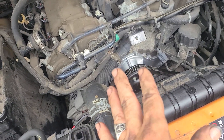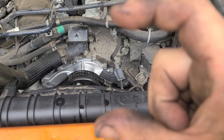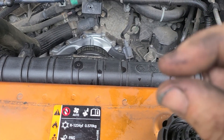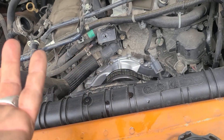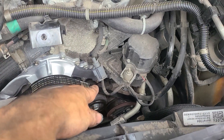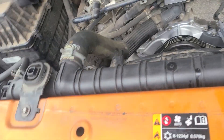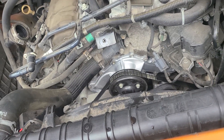There are about 14 10mm fasteners holding the water pump in place. They are different lengths — I think only two different lengths: some about an inch and a half to two inches long, and some about one inch long. The longer ones each have a rubber grommet centering thing that GM likes to use — you can transfer those over or not, up to you. Once you get all 14 bolts off, tap the water pump off. Mine was a little funny — the alignment dowel down there didn't really want to release, but it came out. Make sure you have a catch pan underneath because you're going to dump all your coolant out.